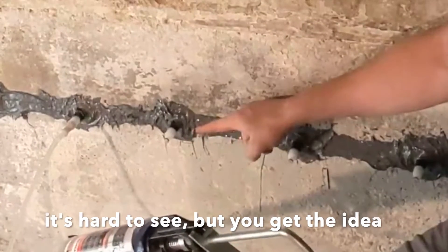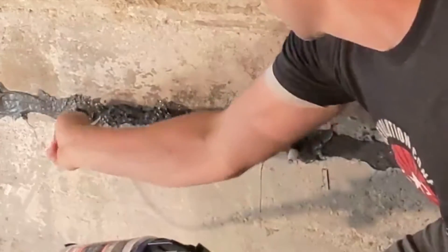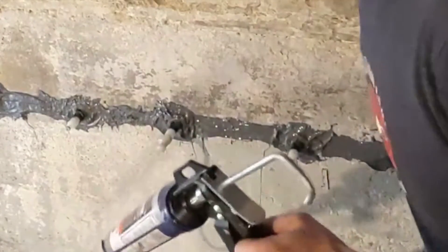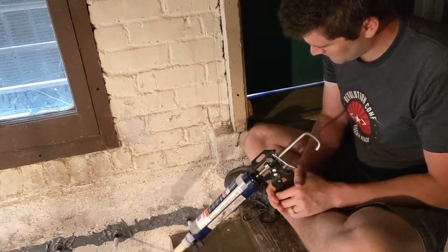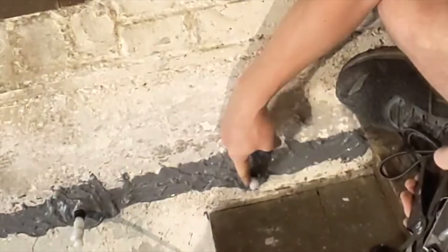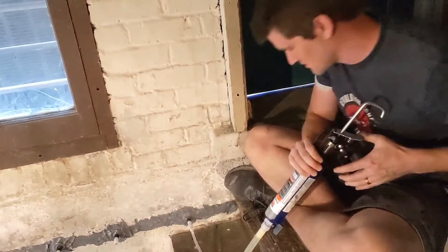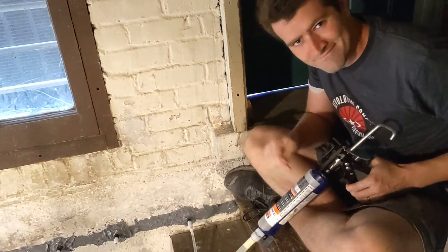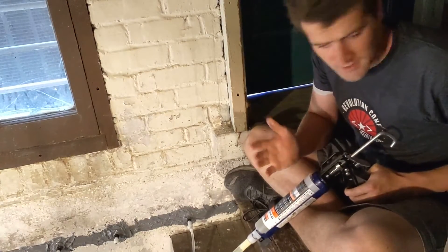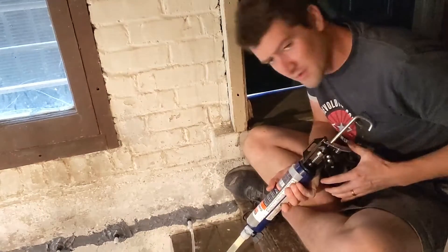As you can see, the liquid started to drip out of the next port. So we're gonna close this one, disconnect, and then reconnect. Follow the same process. The liquid's now dripping out of the next port — the final port. Reconnect. And now the trick is just sort of knowing when nothing else is gonna go in. It can be kind of hard to tell sometimes, but the important thing is that we've filled up most of the crack — now it's just putting on the finishing touches.